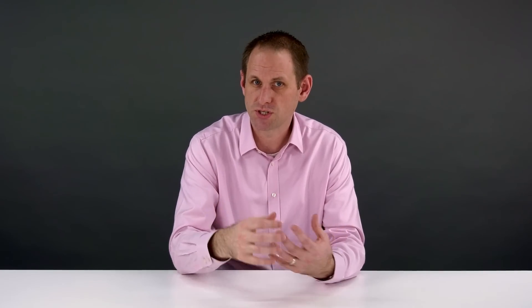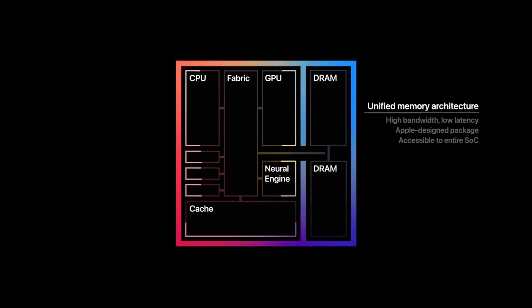It's efficient to take a chunk of data that's not in active use in memory, write it out to an SSD, and then free up space in system memory for active tasks. And because the SSD is so quick, reading that data back into memory is fast enough that you probably won't even notice it's happening. That said, the M1 does do this rather more than Apple's Intel machines do, which probably makes sense given that the memory in the M1 is shared between the CPU, the GPU, and all the other processors in the silicon.